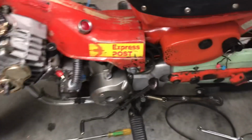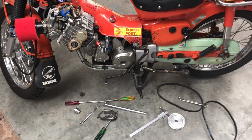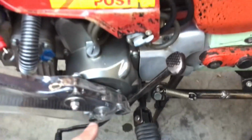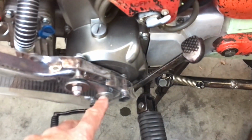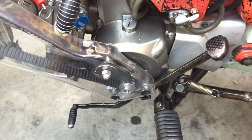So I know that bit works, which is why the backlash noise is not there anymore. So I'll put that together and I'll explain it. I've got it going again. I was wrong before. It's 60 teeth and it was 20 teeth. Now it's 15 teeth. So it's a 4 to 1 ratio now.